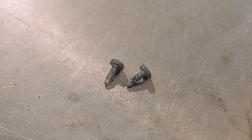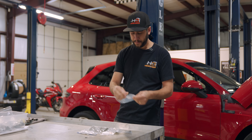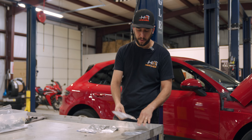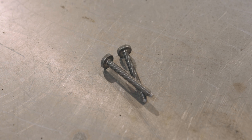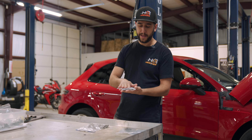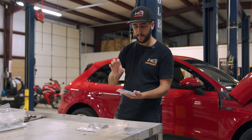So what we do is we back out the old bolt that's broken. Usually it comes out in two pieces, so we get the first piece out, and then sometimes you get lucky and you use a pick to kind of back out the stud that's stuck in the timing cover. And once you get that bolt out, you want to take this new bolt, and also they call it a spacer, but it's more just like a thick washer, and you want to put RTV on the head and the threads of the bolt, put that spacer on there, and put them back in.